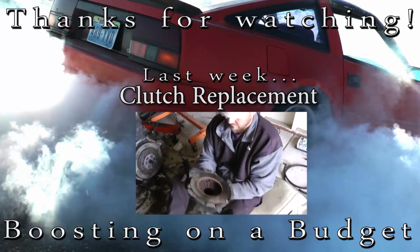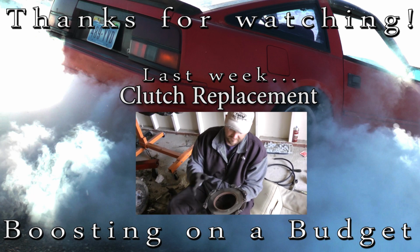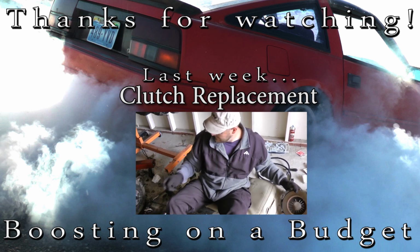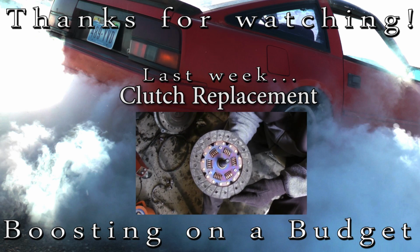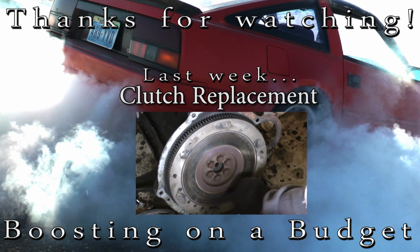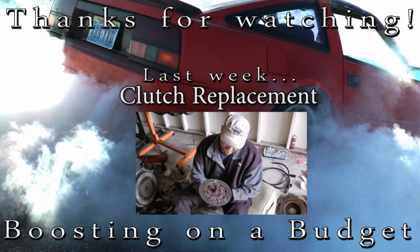What you can do is take a little bit of emery cloth or light sandpaper just to get the scoring off. And that will get the flywheel or the pressure plate good to go for the clutch. Take the clutch out and inspect it. Still looks pretty good. A little bit of glazing on the flywheel, so it's a good idea to go over it with a little bit of sandpaper, a little emery cloth to smooth it out again. And that's about it. Other than that, it looks all right.